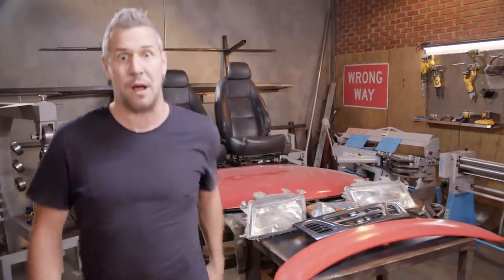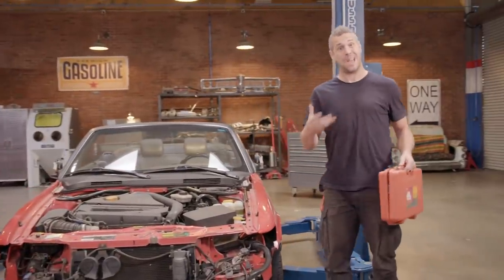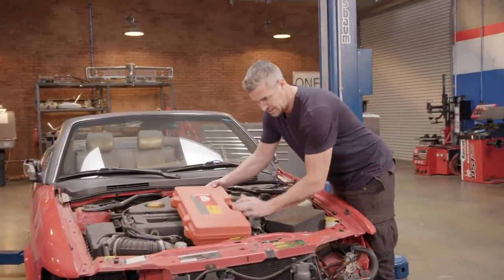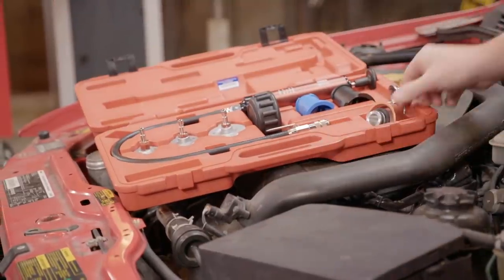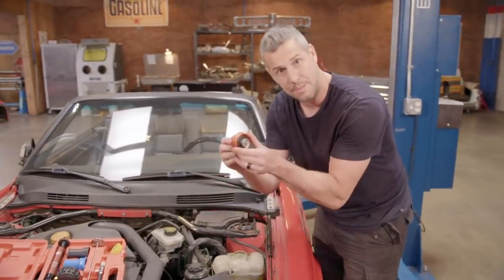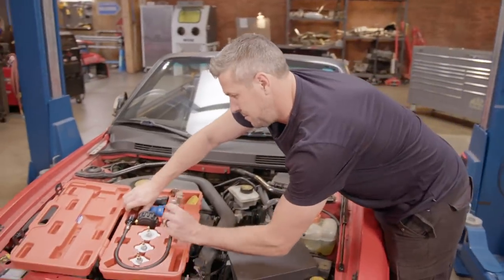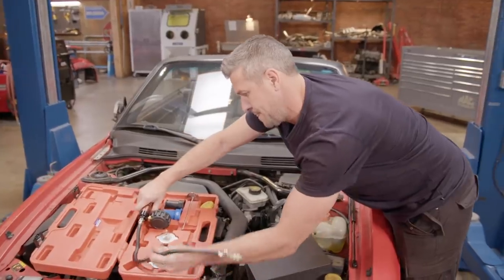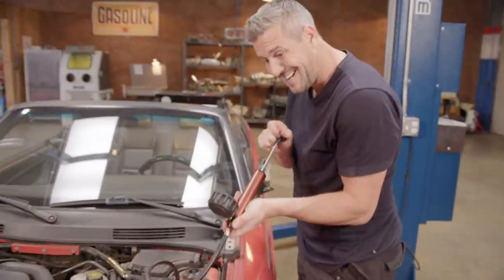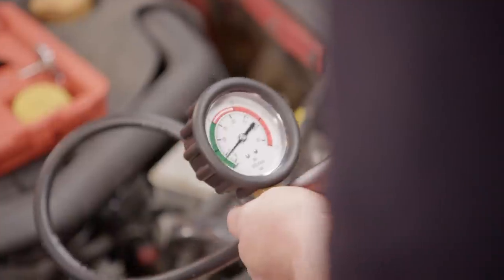So this is Mike's pile. Now, the biggest issue on this car is the coolant leak — no one wants to buy a car with a potential head gasket issue, except Mike, who seems to make a habit of it. To help me diagnose the leak, I have this kit. This piece here replaces the cap on the expansion tank, and just like the cap, it's airtight apart from a little outlet. In the kit there's also this pump, which clips directly onto that outlet, and with the hand pump I can increase the pressure within the sealed system to simulate as if the engine was running.